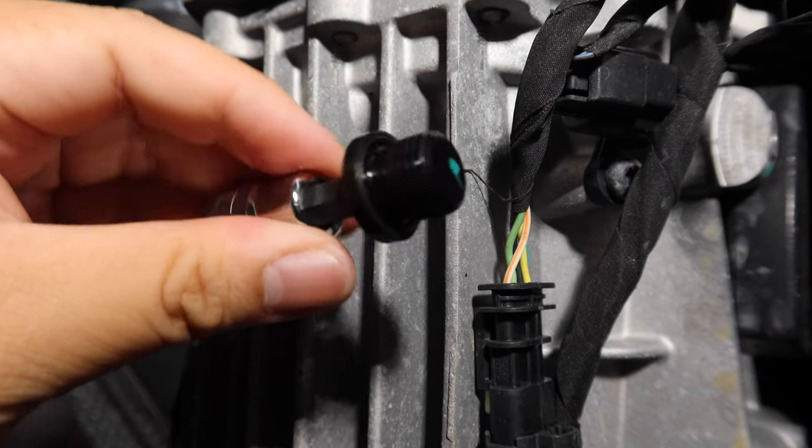This is the fill plug — same thing as the drain plug, no magnet. The plug physically says 'drain' and 'fill' right on it, which is pretty easy to read. The Optimum kit comes with this cup marked with a line — I measured from the bottom to that line and it's around seven and a half ounces. The Optimum Performance instructions say the container has about seven ounces too much fluid, so we're going to drain seven ounces out and then pump the oil back into the transmission.